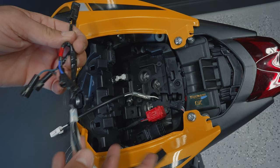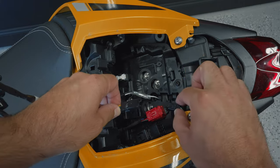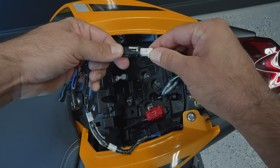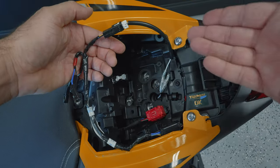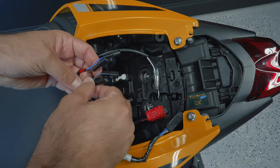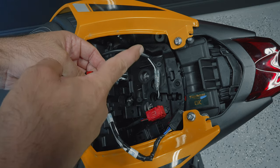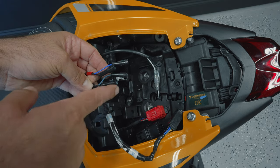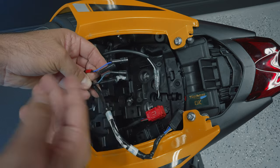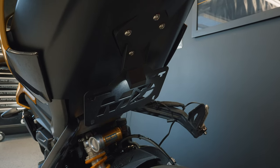Now that everything is tightened, it's time to reconnect the cables. Bring back that multi-cable piece you took off the original tail and plug this end into the taillight, which goes right here. At this point your tail tidy install is essentially complete — you've mounted and tightened the hardware. You've got the cable plugged into the taillight, and what you have left are these four plugs that go into your turn signals. If you've got the non-low-profile tail tidy, your turn signals will just plug in here. For the low-profile version with an integrated taillight, that install I'll show in the next video. The only thing left is to check that the license plate light works, and the tail tidy install is complete.